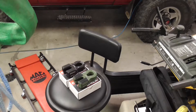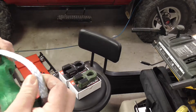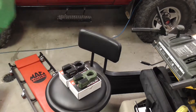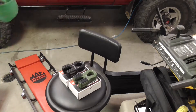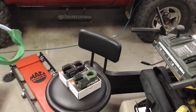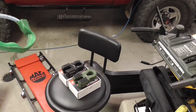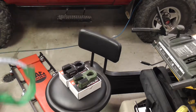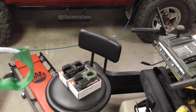When I bought this winch line, they gave me 150 feet, thinking that'd fit on my winch. When I spooled it up, I think this winch line's slightly thicker than the steel stuff, so I found it was too long. I took it back to the four-wheel drive shop, and he sent me to the place where he got it from. They cut off 50 feet and showed me how to splice it.